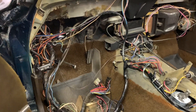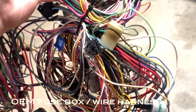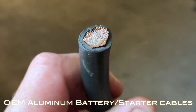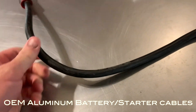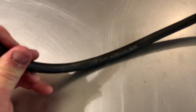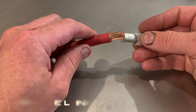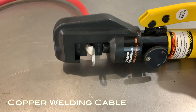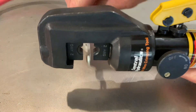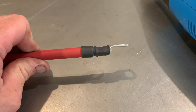With the dash out of the car, it was also a perfect time to go ahead and replace all the old ratty wiring with some new stuff. The old wiring is a fire hazard and also undersized to support electric cooling fans, electric fuel pumps, and the other things you need with a fuel-injected setup. The starter and battery cables were big enough gauge-wise, but they were clad aluminum, and aluminum can carry eddy currents which can interfere with signals, so I replaced those too with good copper welding cable.